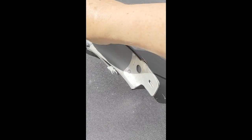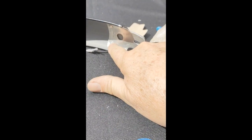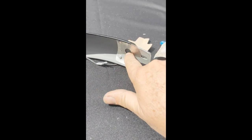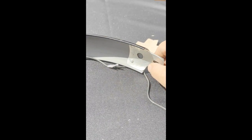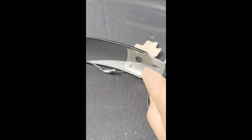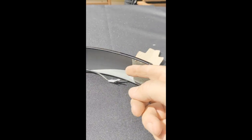Just remember, the length of these rivets is important because we don't want them to foul on the wheel. Just make sure you've got enough clearance there. Make sure that when it's clamped in, there's no danger of this coming off and catching the wheel. Because if it does, remember the wheel's going down at this — it'll really mess it up, probably cut into your tyre. So just be careful that that's not going to be able to pull off.